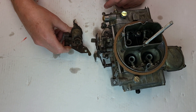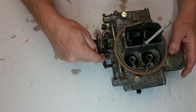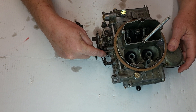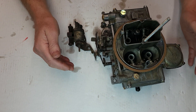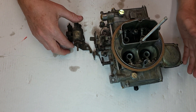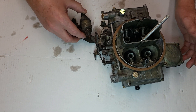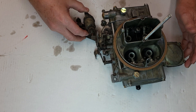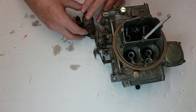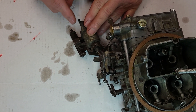What happens here is it stops the engine from dieseling. You would set the idle speed by the curb idle screw very, very low — like 450-500 RPM — just barely staying running, or maybe on the point of not running. Then you'd mount this solenoid on the throttle. It would sit right up against it at the right bracket. And you'd have an electrical wire here from 12-volt ignition.